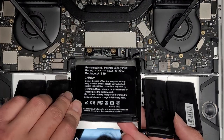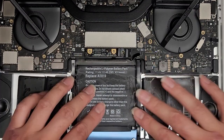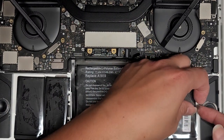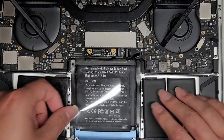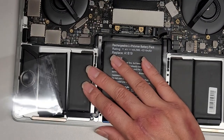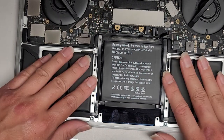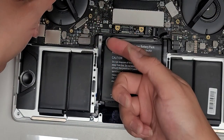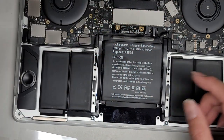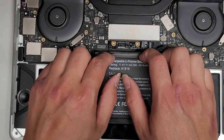Get the battery in there — there we go. We're going to kind of drop the battery packs into place, but it doesn't really line up right, so I'm going to peel this alignment piece off and readjust it. Normally you'd leave it on because it helps with the alignment. I peel this by rolling it back like this. We're going to get this battery connector in first — take these little props back out and get this lined up.